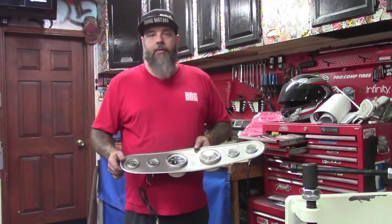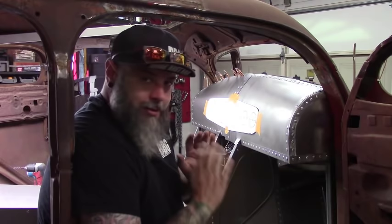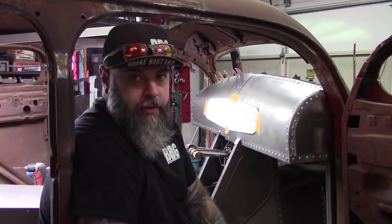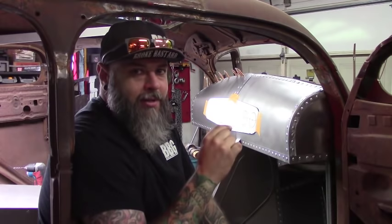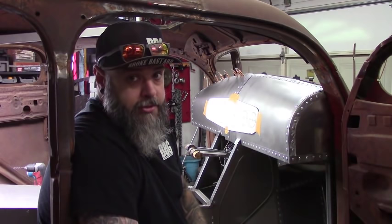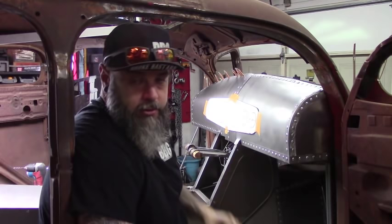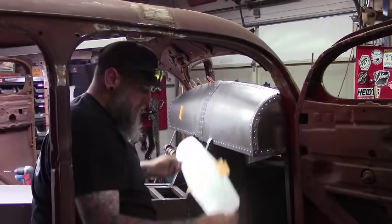There you have it — that's what all this work was for, to make this one piece. It's the look I was going for. Now we just have to get it in the car. Next morning, I came out, squared up the template on the dash, got it all where I want it, taped it in place. We're going to mark the center points on all the gauges, drill the holes through the dash, then open them up a little to accommodate the ring for tightening. We'll try to use the hole saws again to drill through so the face plate can go on and the gauges can sink through the holes in the dash instead of cutting out a giant circle.